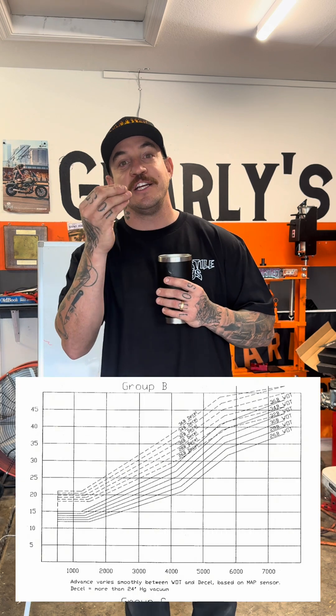That is Timing 101. Thanks guys — if you made it to the end, you're an absolute legend. Put any questions in the comments — I'm going to be more active in the comment section to help you guys out. Let's recap: we talked about peak optimal timing after top dead center, initial static timing, advancing timing when hitting the gas, and advanced curves because when you go into DynaTek or Daytona TwinTek's instructions they reference advanced slopes and curves. Part one is all about timing. Part two is all about the rev limiter and the sound — and having fun. Thanks for watching. My name is Cam and this is Gnarlies.